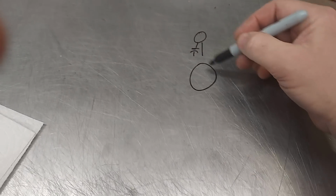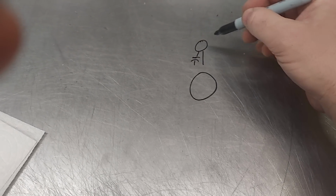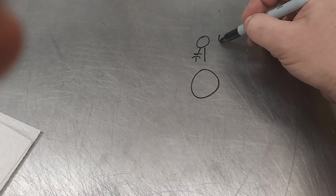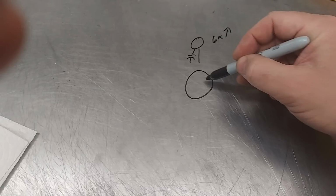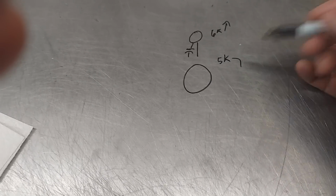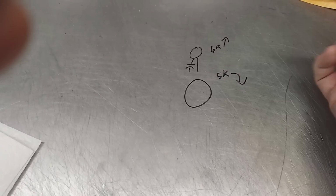And what this does is the cap not only lets the tweeter only play high frequencies, like say from probably 6K and up, and then the woofer will roll off probably right around 5K on its own. So it doesn't need anything else. Some people actually prefer this.